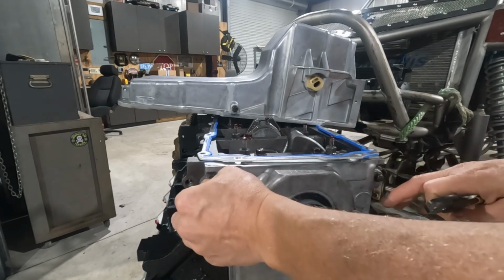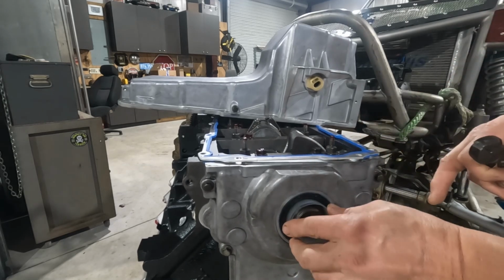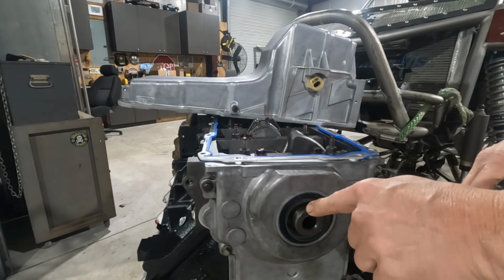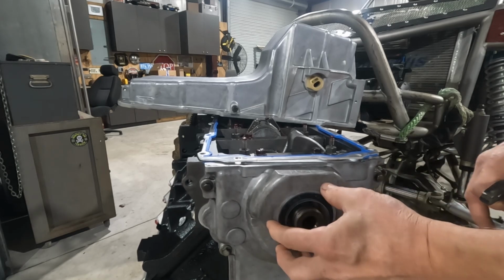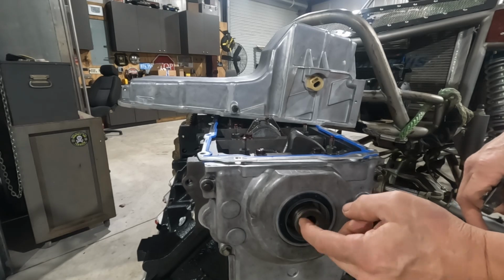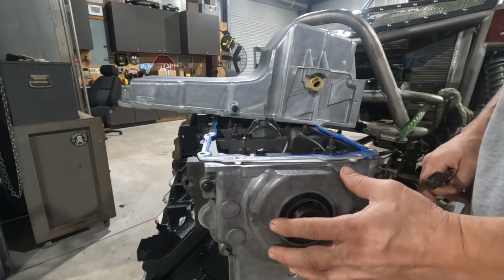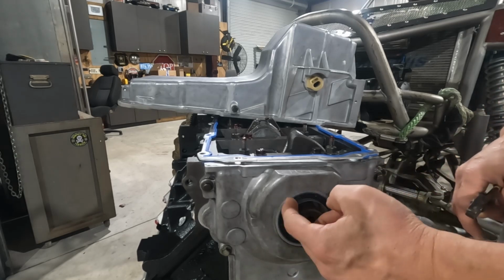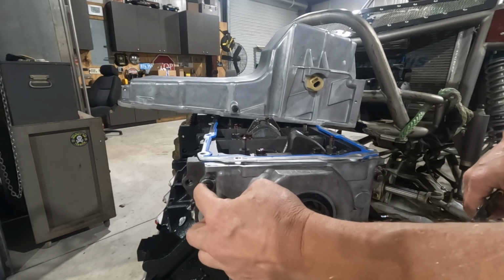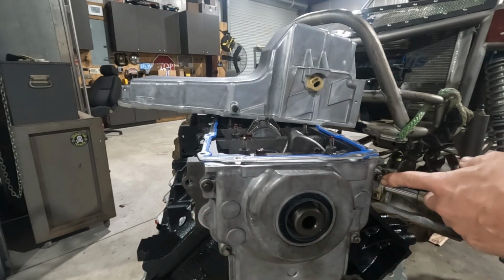with this loose, all the bolts, you just finger tighten them so that this housing can move. You snug this piece down on the snout of the crank, and it centers the seal the proper distance from the crank snout so that when you install the balancer, it's sitting concentric with the seal. And once that's done, then you can go through and tighten up the bolts to 18 foot-pounds.